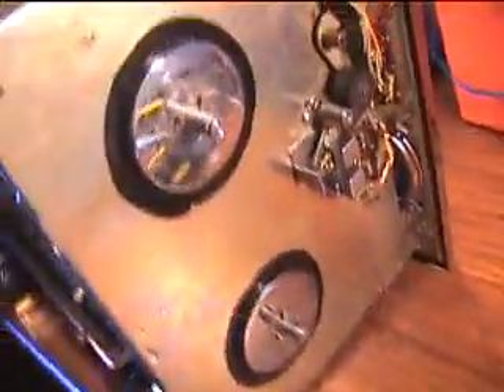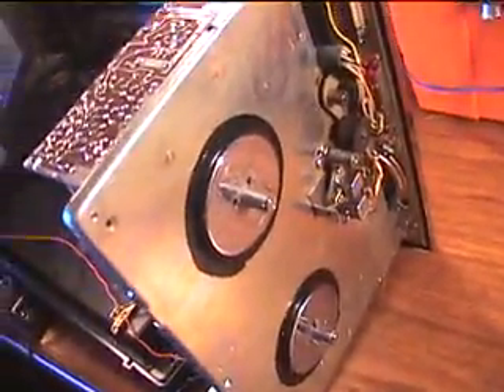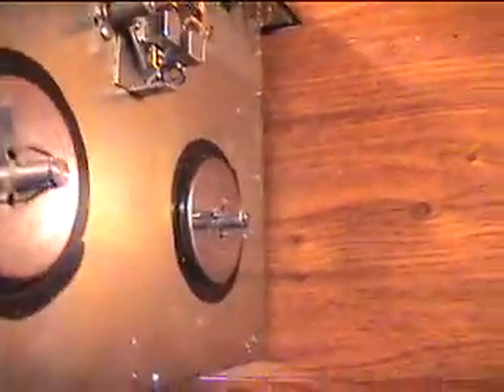On the other side of the machine you can see the reels. When I took the top part off, I was surprised — I was expecting to see idlers and things like that to move the reels, but it doesn't really use much in the way of idlers. It's mainly a belt-drive device, but all that is on the other side. Actually, there are no real idlers except for the thing that pinches the belt during rewind.